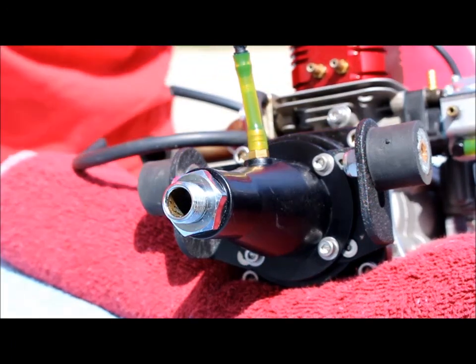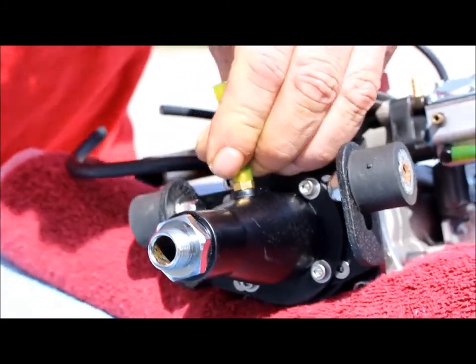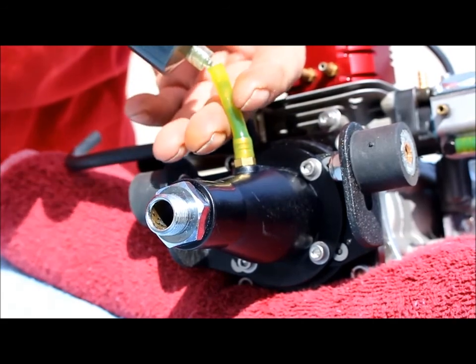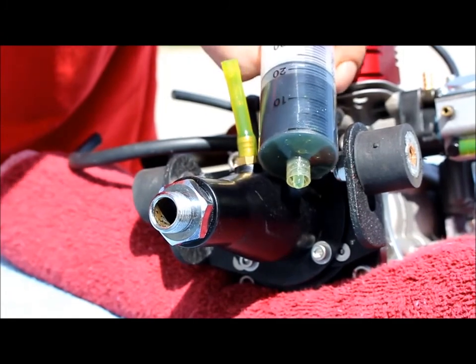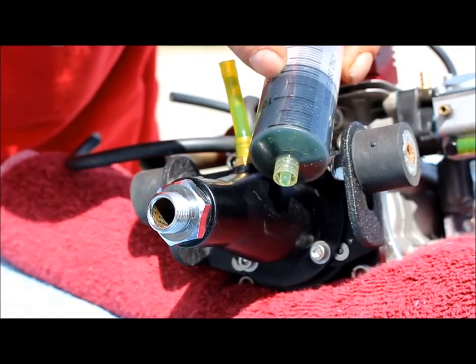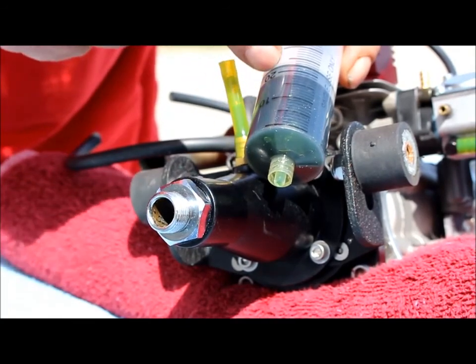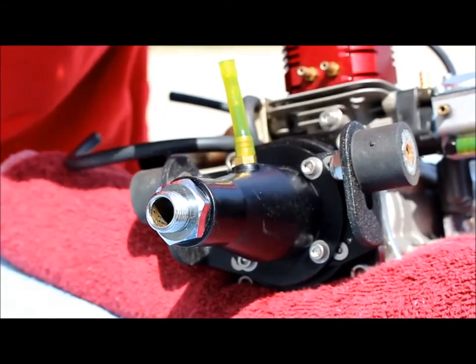Okay, since I cleaned it out, there's absolutely no double O grease in the cone, so I'm going to put 1/2 ounce of double O grease. Let's see if you can see this, I'm starting at just about 20, so 1/2 ounce is just about 10 milliliters, and that's what these are, milliliters. So I'm just going to push this down till it just gets over the 10 mark there, and that should be good.